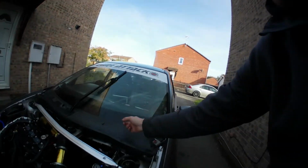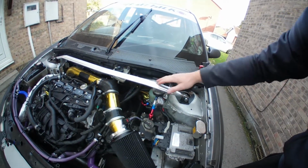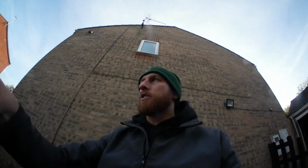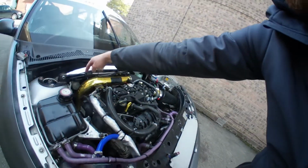And then for the engine bay, obviously I need 4 in the engine bay as well, so my plan is come through the bulkhead, have one for the fuel here, pointing towards the fuel and the exhaust area, have another one down here pointing to this area. I know this isn't highly likely of getting fuel, but you need one in each corner of the engine, so it kind of covers the engine completely. No matter where it's going to come from, it will cover it. Same again, so I'll run it around the engine, have one pointing that way, and then again one pointing down there. So that's the plan of action.